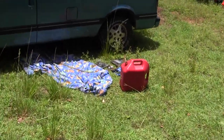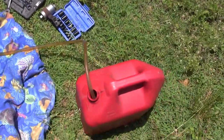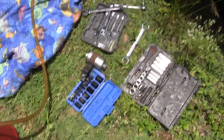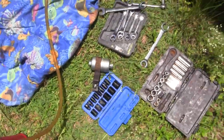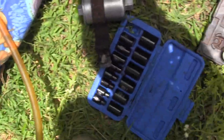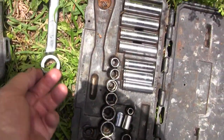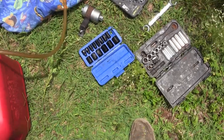I'm trying to replace the fuel sending unit, fuel level sensor, and fuel pump in this 1994 Astrovan. To get the gas out of it you could siphon it, which is what it seems to be doing right now — a little bit here and there, I can see the air bubbles. But I had to take this fuel filter out. It's a 14 millimeter to get the bolt loose, then a 20 millimeter to hold the big fat connector here, and then a smaller wrench, either 19 or 22 — I think it was a 19 flare wrench, because you really got to torque on that thing. They're really tight.